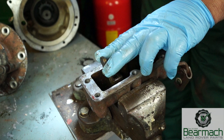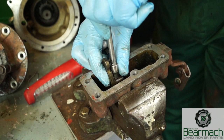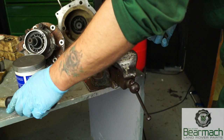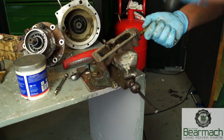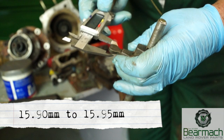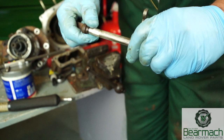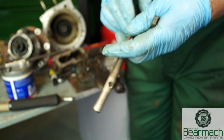On the high-low selector housing the lever is held onto a shaft with a grub screw — the same allen key size as used for the detents. This is quite an effort to get out because it's thread-locked in, however with a good allen key tool you'll be able to unscrew it. Once the grub screw is out, with the housing in the vice and using a soft hammer, tap the lever off the shaft — you might find a bit of resistance because of corrosion, but it will come off. Again with our vernier calipers we're measuring the lever in exactly the same fashion as the diff lock — it needs to be within tolerance. The o-ring here will also need to be changed; it stops moisture getting into the housing and into the transfer box.